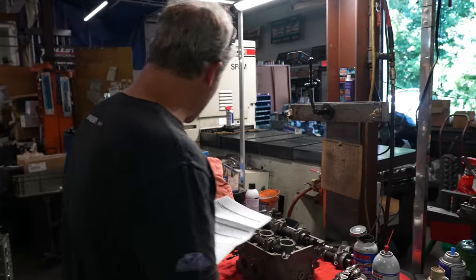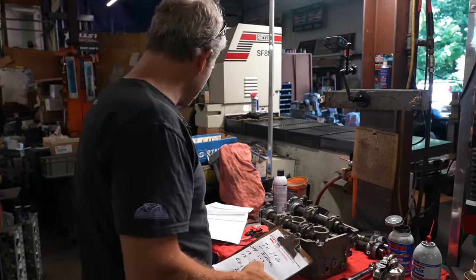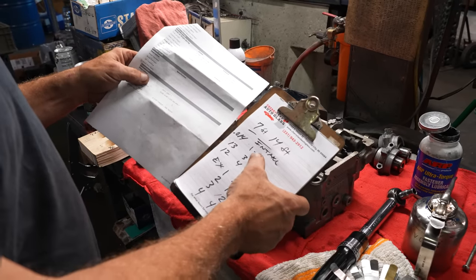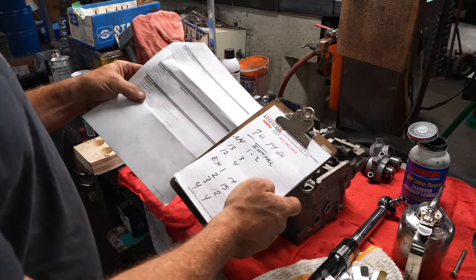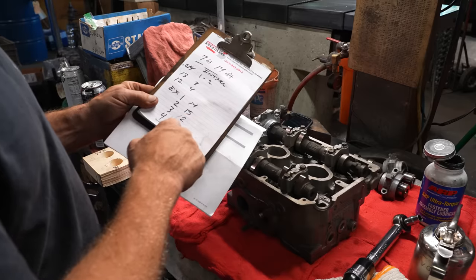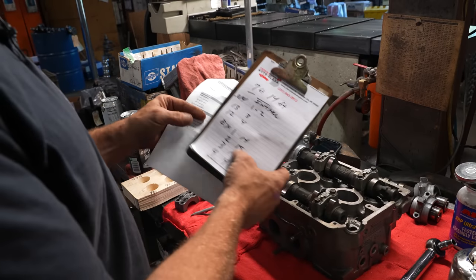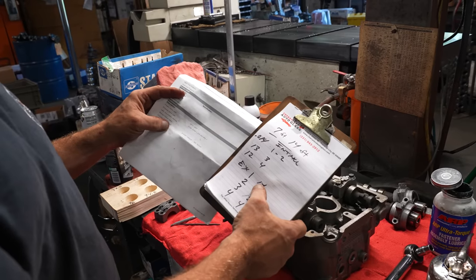So what I did is I went through, torqued everything down, and now I measured all of them. So for instance, all my intake numbers are loose. So call it 7 at a minimum. I'm at 14 and 13 and 12. On my exhaust, I got 12 as a minimum, and I'm really a little big in all cases. This one, I'm not sure, maybe that cup's not all the way seated, but this is definitely too tight. This is close. 15 would not quite be in there, and 14 is in spec.